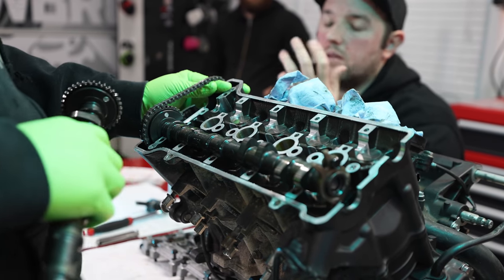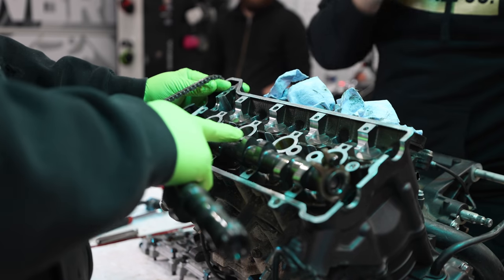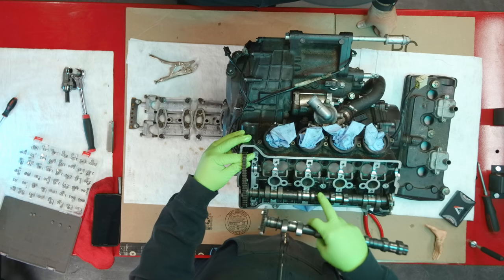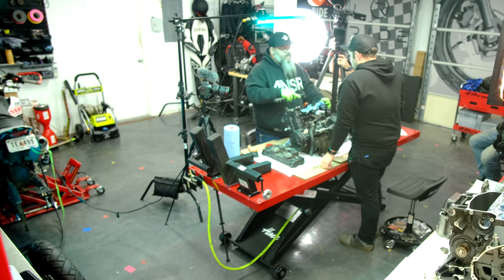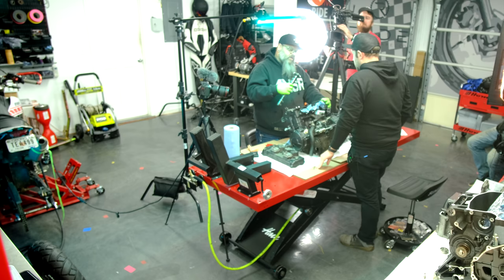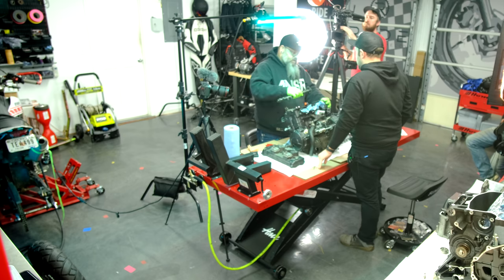You're hoping to. Now, the reason why I'm saying you're hoping to is if you can see the camshaft right now, it's not in here flat. It can't be in here flat because these lobes are pushing on the valve springs that are closed right now. And this won't lay flat until we put the caps on and compress everything slowly. So you want to try and make sure that you get this right, because you don't want to go on and off with the caps. Doesn't sound like a fun thing. Okay, so...